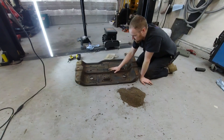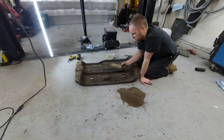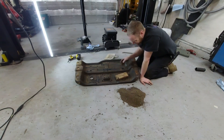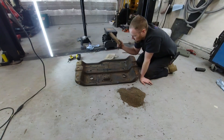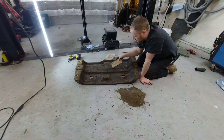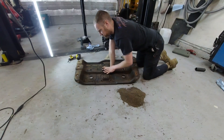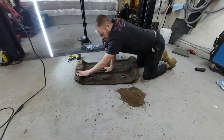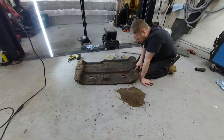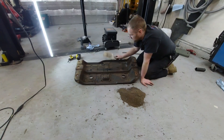So I just finished cleaning off the belly pan — it took a little while. I used a piece of wood to scrape it so I didn't scratch the paint too badly. If you have a Jeep or any vehicle that has a belly pan that can collect debris like this one does, you definitely want to clean that out. You can see some red rust right here where it goes against the frame — anything like that happens because this collected debris holds moisture, and when it's holding moisture, things are going to rust. I cleaned it off pretty decently and I'm going to spray that surface with some anti-seize to keep it from having a problem again.